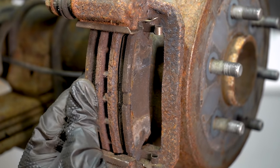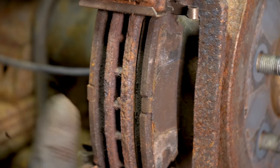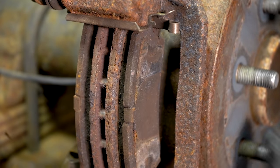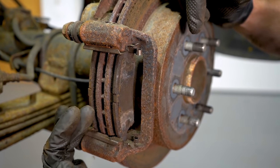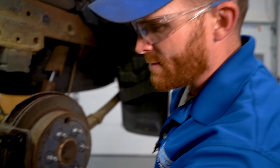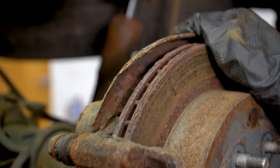Your brake pads are supposed to be able to move around inside your bracket very freely. This one right here isn't moving at all — this one I can move a little bit, so it's fair. But a stuck pad can cause a big issue: when I step on the brake the caliper squeezes, and as soon as I release, the caliper releases a little and is supposed to release the rotor. If the pad is stuck, it's going to cause constant friction and keep wearing that pad away. Your brakes are under a tremendous amount of pressure every time you step on the pedal. Also, if you have bent tins hitting the rotor or a bent backing plate hitting the rotor, those will cause issues too — more than likely you'll hear a loud squealing noise. But with a stuck pad in the bracket, you may only feel a slight brake pull, especially in the front where you'll feel it in the steering wheel.